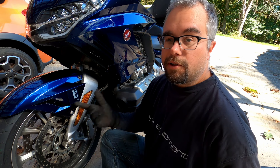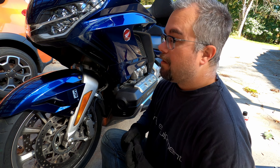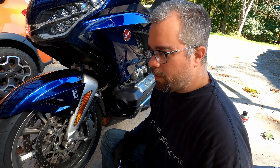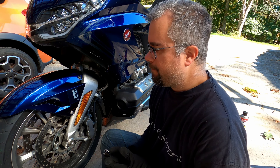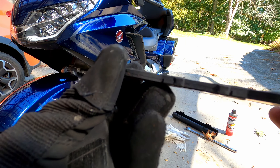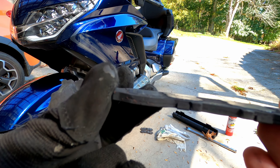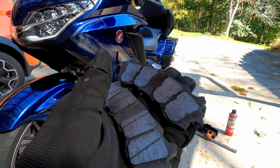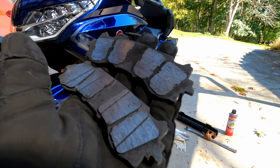You've got to do it twice because there are two sets of pads on the front of the Goldwing. The other side is the same, just the different side. Here are the brake pads from the other side — you can see they're just as bad as the other side was too. So both sides really did need new sets of brake pads. That one's gone completely — that is bad. If I had ridden another couple hundred miles or a thousand miles with these pads, it would have damaged the rotors probably. That was close.